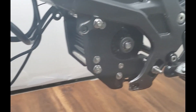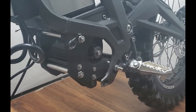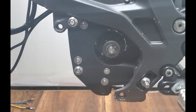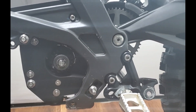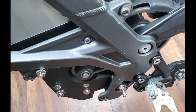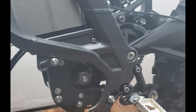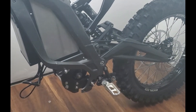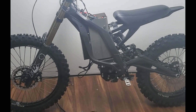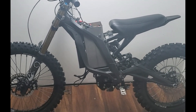We're in a nice position because we can have these made in aluminum. I'm hopeful that even if this is not a viable design for running power long term, maybe it'll get us a few kilometers so we can check that everything's lining up properly. I'm going to show you a clip of when I had the primary reduction hooked on. What I need to do now is take all of this apart this weekend, put it back together with the proper torque specs, get it greased and made secure — because if I run it right now it's probably going to fall to pieces within the first kilometer, as it's really just to check fit and for show.